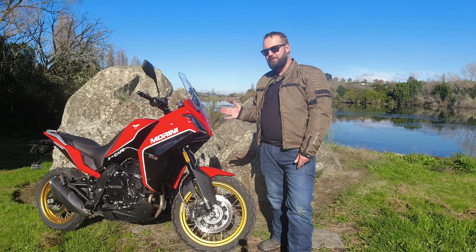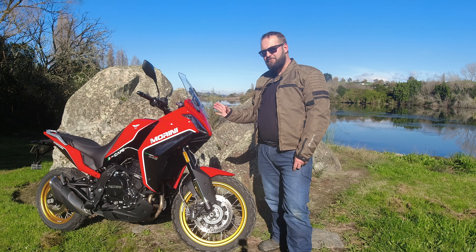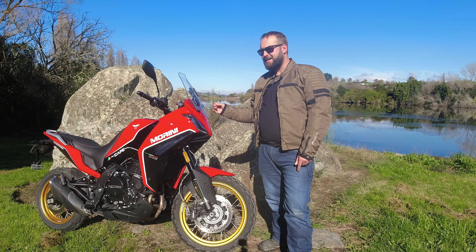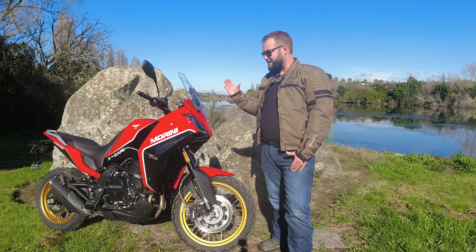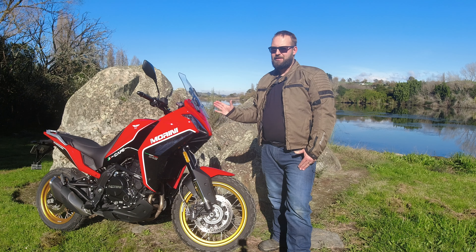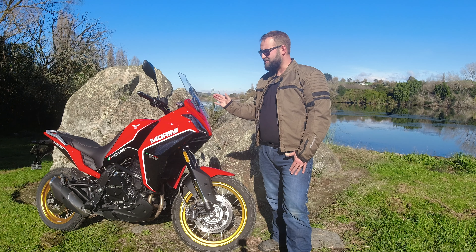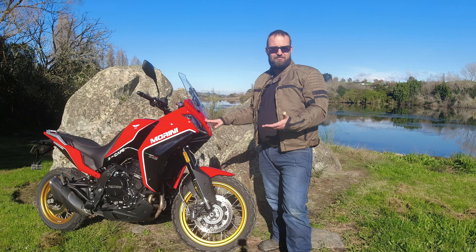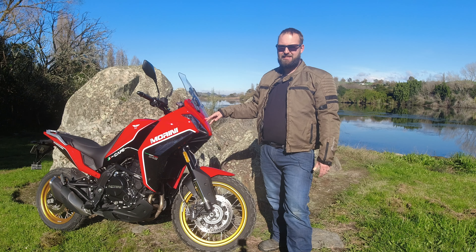This bike has an 18-litre fuel tank and I've been keeping track of fuel economy over the last 987 kilometers. I'm quite happy with it — it's been getting better and better as the engine progresses through its break-in period. It started off in the high five litres per 100 kilometers and now we're in the mid fours per 100 kilometers. I nearly ran it out of gas but chickened out at the last minute. I got 360-odd kilometers out of the fuel tank before filling up, using 15.5 litres with 2.5 litres still in the tank — so theoretically you can get 400 kilometers out of a tank easily.